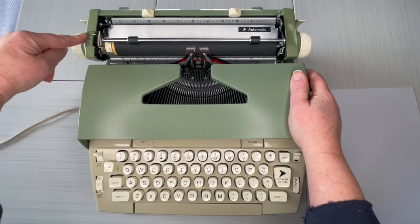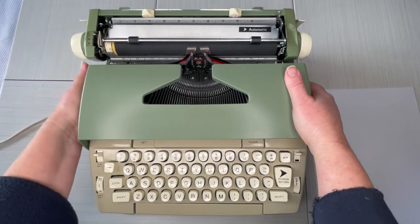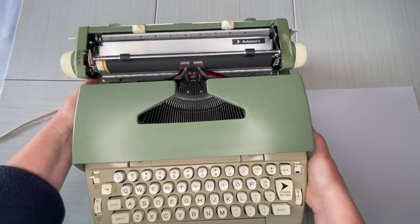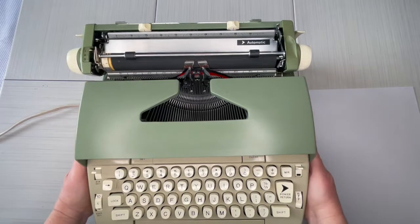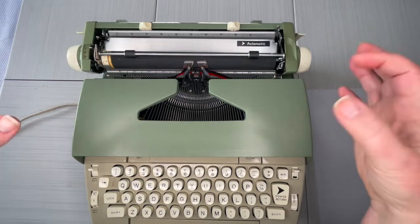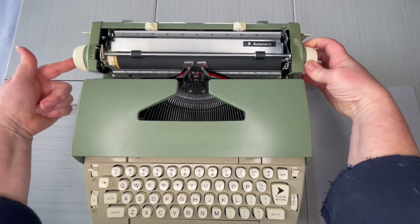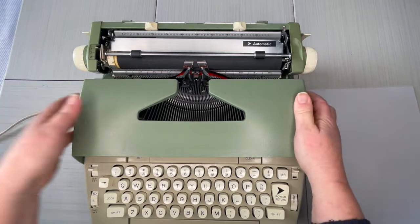When you hit your power return, it's going to advance 1, 2, or 3 lines. Now this little black button right here, can you see that? That is for when you turn the handle and hear it clicking. What if you're using lined paper and trying to line it up just right? This can get really annoying. So you just press that in while turning the handle, and it releases the roller and you can line things up just right. That's what that's for.